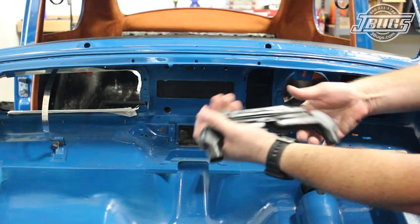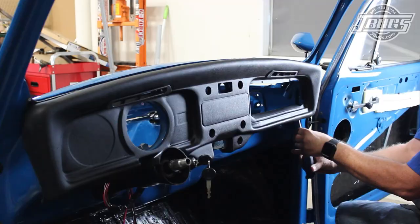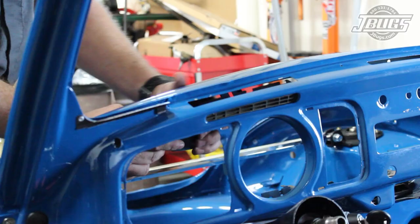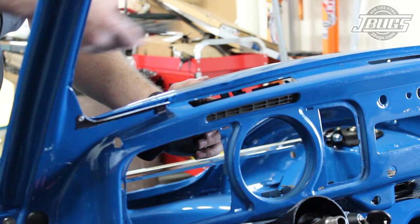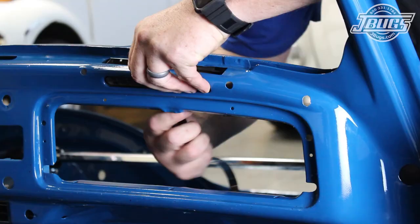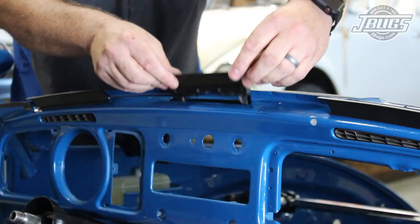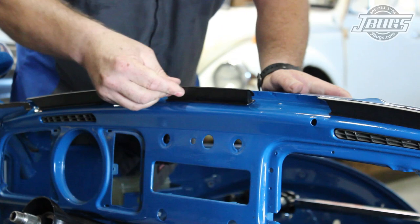While the dash is cooling, we get our center left and right dash vents and ducts mocked up and ready. Then we pull off the dash and set the left duct in place, lining it up with the face vent first, then popping in the dash vent to hold it in place. The installation is the same at the right side, then we snap the center dash vent into place and snap the duct work in place underneath it.